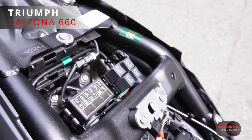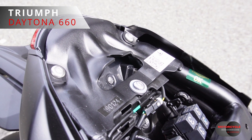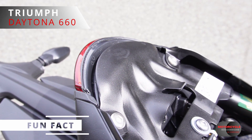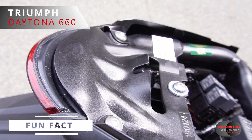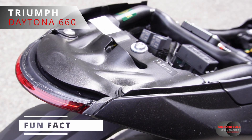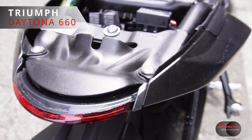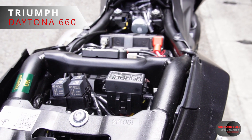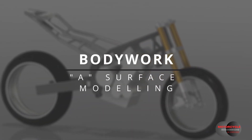Here's an example of the Triumph Daytona 660. This bike uses a modified version of the Trident 660 frame, and we can see the bodywork is mounted to the top of the tubes and then on the pressing at the back. I'd originally designed this rear pressing with the form on the back to give clearance for the tail light, follow the profile of the bike whilst providing stiffness, and also to try and prevent theft since it would be more difficult for thieves to reach the seat latch cable.